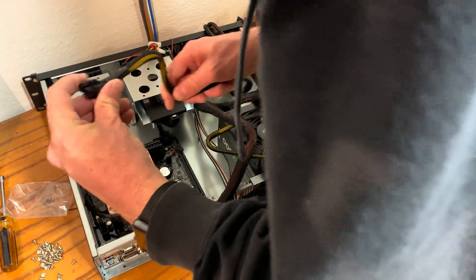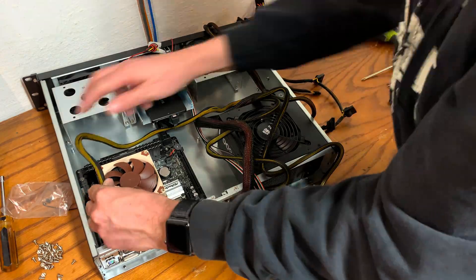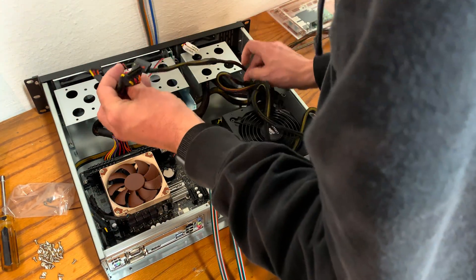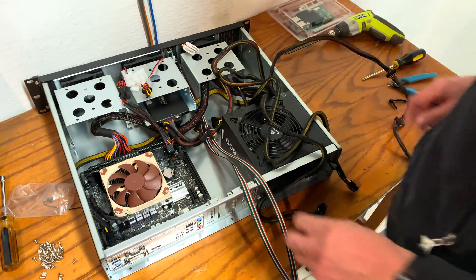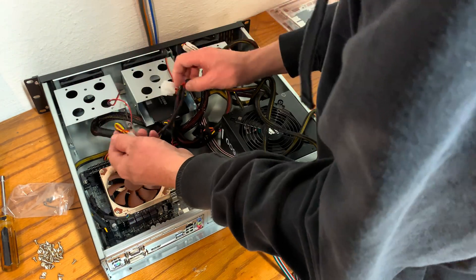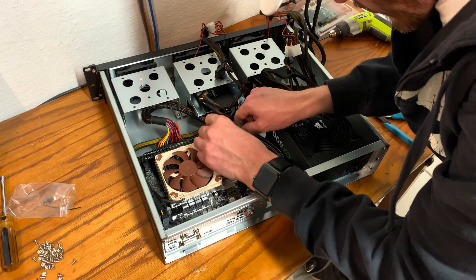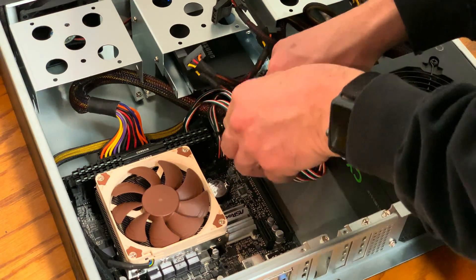As you can see, I'm going one at a time straightening the cables and making sure everything is routed in the best possible place. Make sure your power supply also has the standard molex connectors so you can pair up the old fans using those connectors. Again, routing the cabling is very important to keep them out of the airflow. Most wires are pretty tolerable to tension and pressure, but do not over-tighten your zip ties when doing cable management.